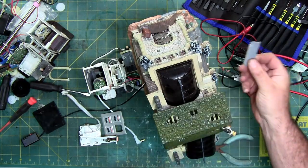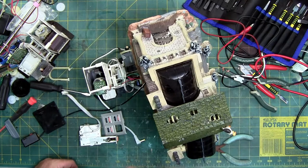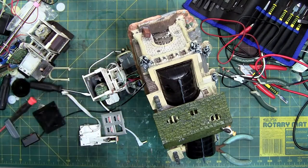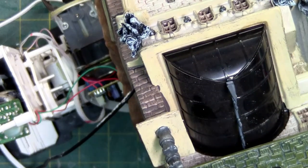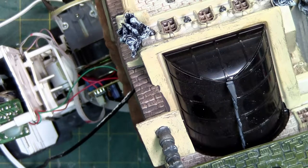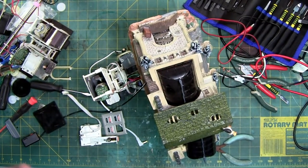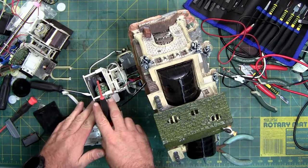On the front entryway there's a great piece of plastic — it is glued to the porcelain. Pop it off with a screwdriver or a spudger. Using a long, thin screwdriver, you can see right there there's a Phillips screw in the top corner. Reach through the door frame and unscrew it. Once you unscrew it, he falls, and then you can lift him, push him in, and allow the doors to close. Once you do that, you can remove the bottom. Even if this fails in its worst positions — this guy wedged against the backer door and this guy stuck in the open position — this still comes out without any problems.